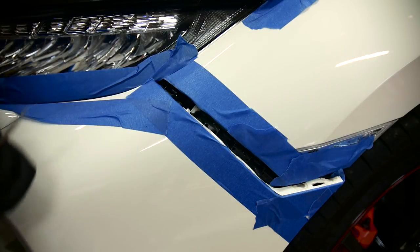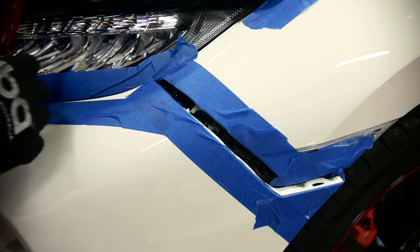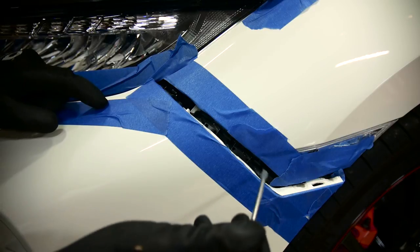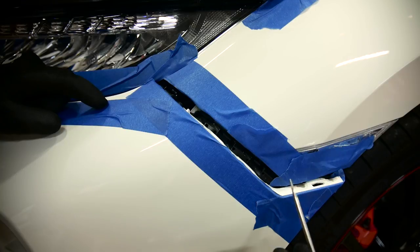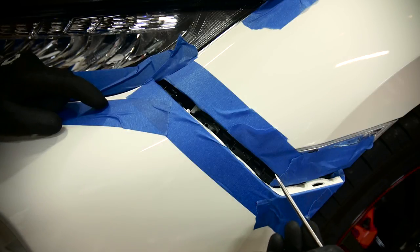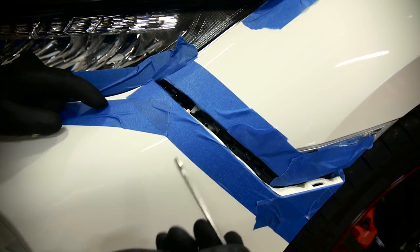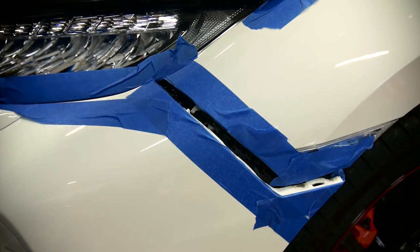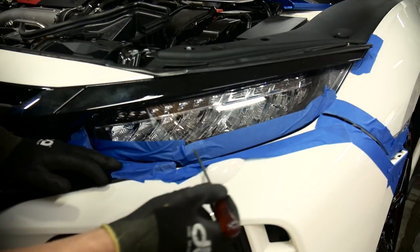I will go through this step by step and we will start with taking off the front bumper. As you can see, we have put some tape here to protect the paint of the front bumper and the fender. When taking this bumper off there are three little clips right here that you need to go in — just use something plastic and then knock that one down and the front will easily come out. Here are another two clips that need to be pushed down; there is one here and one here.